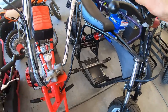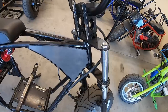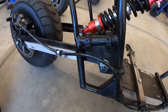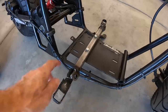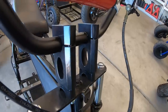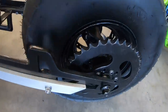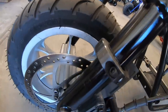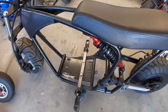This bike here is a work in progress — I'm waiting for the kit. I'm just going to make a QS138 e-bike out of it. It's based off a Megamoto 80-105 or Coleman frame — same thing. The bike uses a Go Power Sports swing arm kit which I converted to a monoshock, got rid of the dual shocks on the back. It uses a Go Power Sports foot peg relocation bracket and a Go Power Sports suspension kit. It also has handlebar risers and handlebars I picked up off Amazon, and of course it's running the 420H sprocket for the e-bike kit. The Go Power Sports front brake worked on the aftermarket 8-inch street tire wheel, which you can get on AliExpress. This will definitely be a fun build once I get all the parts put together.